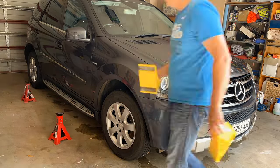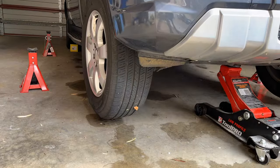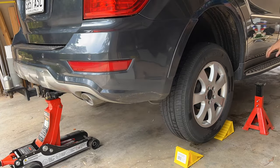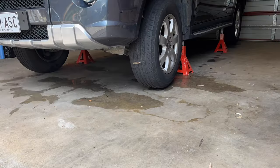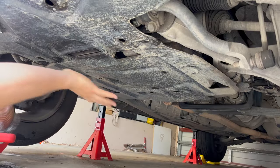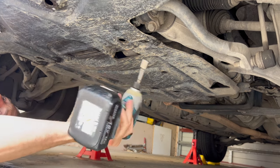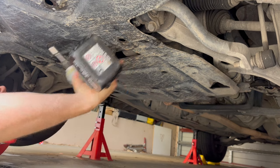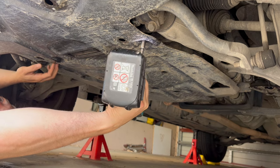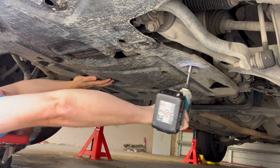Let's get this car up on the jack stands — I'm putting it on time-lapse. If you need a detailed description of how to safely put your vehicle on jack stands without damage to the vehicle or harm to yourself, I'll chuck a link in the description. To start, we want to take the undertray off — there are six 10mm bolts, one here, one there, a couple back here, and a couple down the back. I'm just using my impact to get them out easily.